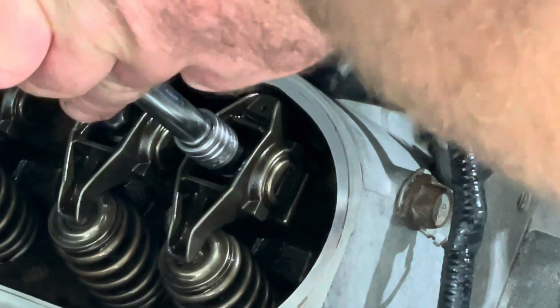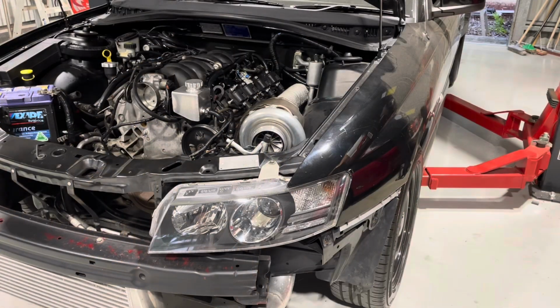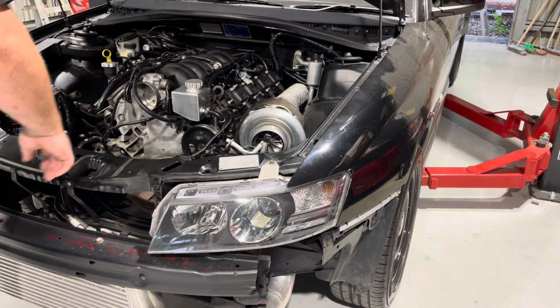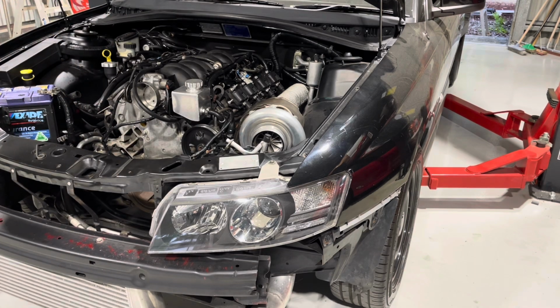So they're all torqued up, they're all done. Valve covers, let's put the valve covers, coil packs back on. All right, valve cover, rocker covers, what have you, back on. They were 8 foot-pounds, torqued down. All the coil packs back on. There's obviously no water pumping in there. I had to plug in a few places so it'll start. Yeah, probably take a bit, but cold start of the 85's never been great, it always seems to go second go, but yeah, we'll give it a go.